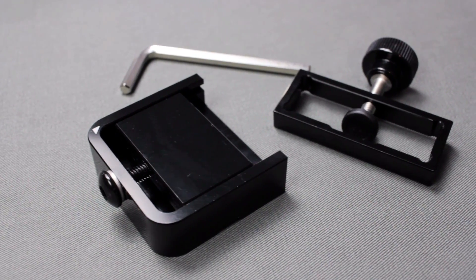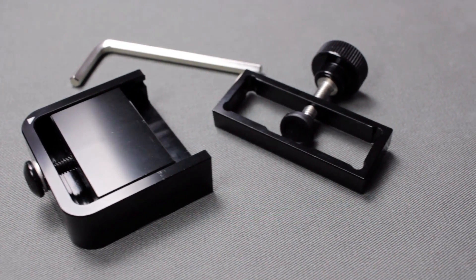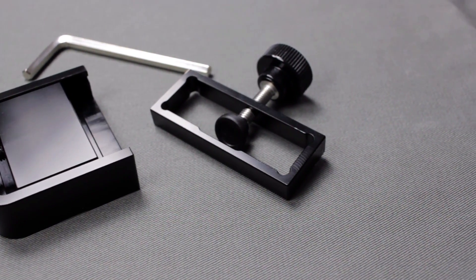The principle is the same: you have the base where you put the CPU inside, and you have a small slider which then pushes the IHS to the side to delid the CPU. I will show in detail how it works — I just have to unmount the camera and put it closer here so you can see in detail how it works.